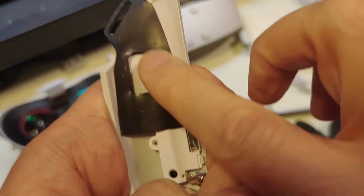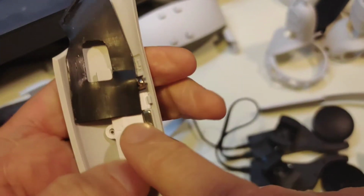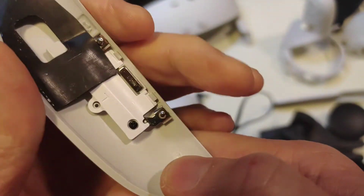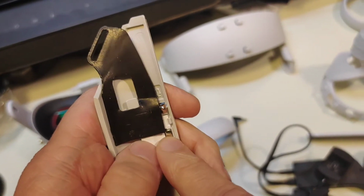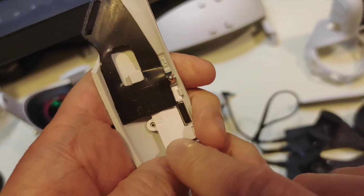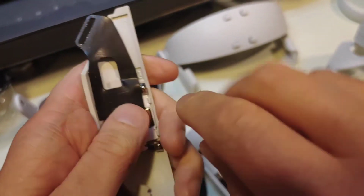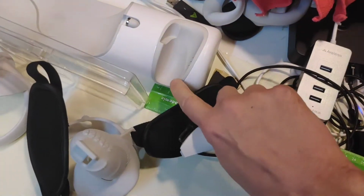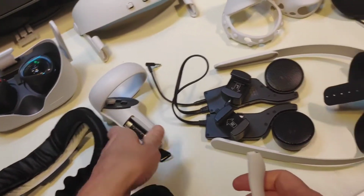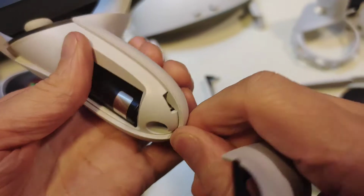It's built this way because of the shape of the stock Oculus Quest 2 battery panels. And it's not much effort to be able to modify. I mean, you could completely take this off, put it under the white part, or you could just unscrew the top screw here and put a nut underneath it and then screw it down over top of this through the hole, and it'll stay a lot better. Those are the alternatives that you could use for utilizing the side mount charge interface of these.